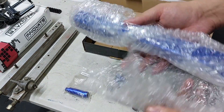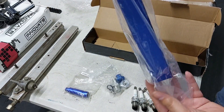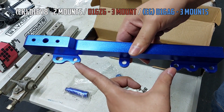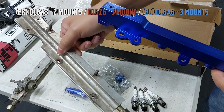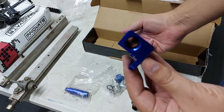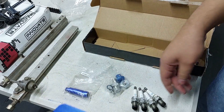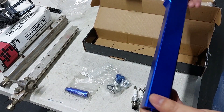This I believe is a copy of the AEM design. It has multiple mounting points because if it only had the outer and middle it won't work — you need the two center ones. The P2P or P2K intake uses a different mount with only two bolts, while the older D16A6 uses three holes, so this is a universal one that works on both. The big thing is this is the feed side — look how big that hole is. Now we don't have that small feed issue anymore, and the regulator sits at the end rather than on the feed side. This fuel rail should solve the uneven burning, which is dangerous because if the last cylinder runs lean you can blow up the engine and the AFR gauge won't even tell you why.